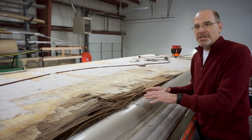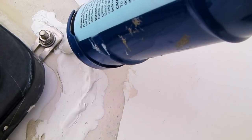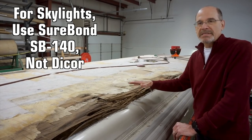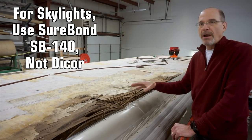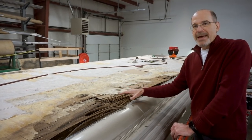So don't let it get to this point. Check all the seams again at least about every six months, certainly no more than once a year. It doesn't take long to examine the DICOR and make sure that there's no chance water's leaking in. Don't let this happen to your RV.